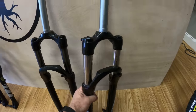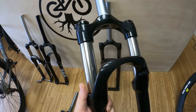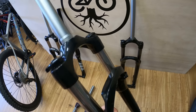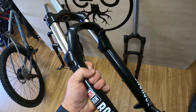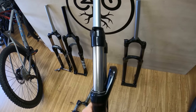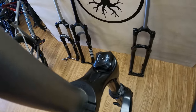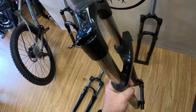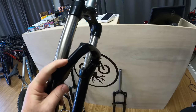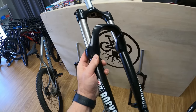Starting at the bottom, this is the RockShox 30. It has 30 millimeter stanchions. This actually has a coil spring in it — no air. It's a decent shock; I haven't had any complaints. I've ridden a few bikes with it — they're not bad. If you start to get into any bigger riding, you're going to meet its limitations pretty quickly. You can adjust the preload on the springs and also the compression, and you do have a rebound as well. In one of the next videos, I'll talk about what all that means.